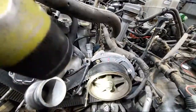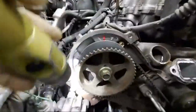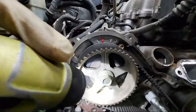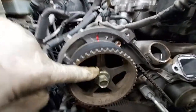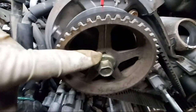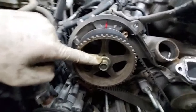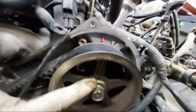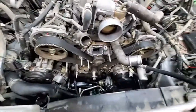The way I know I'm in timing is because you see the one on top. Check if you can see the camshaft sprocket — the key way groove is pointing up. And the driver side same way, the key is pointing up. So that's the timing on this one, that's if you guys already have everything apart.